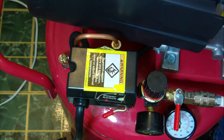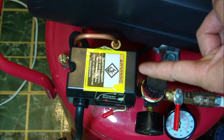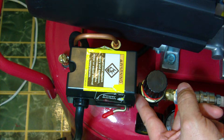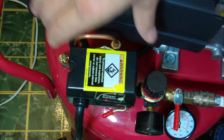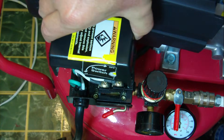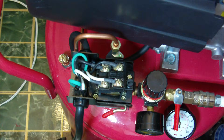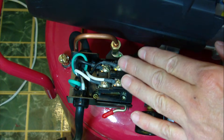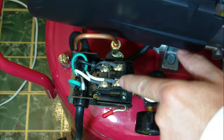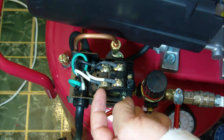I've already taken it out. Down on this side, there's like a little notch. And sometimes you have to put your screwdriver in here and kind of push on it a little bit to get it off. I've already got it loosened up. Sometimes you really have to work at it, so I suggest you unplug it, because these wires right here above my fingers have power on them when it's plugged in. These two are for the motor and these back two are for the cord.